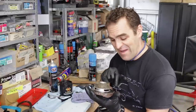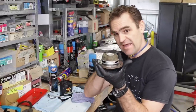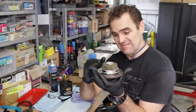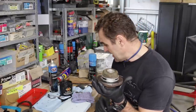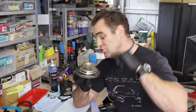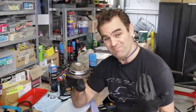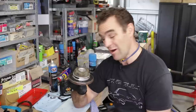All right, my gaskets are made up and I've put a layer of grease on both sides. Basically there's a paper gasket between this base plate, this screen, and then another one on top of the screen — so there's sort of four layers here. Now I'm going to go through and put it all back together again. You should generally replace all the copper washers when you do this — that's recommended, they come as part of the kit — but I didn't get the kit, so I'm going to have to use the copper washers again and hope that they work.